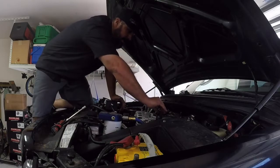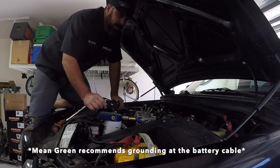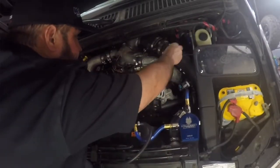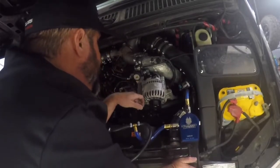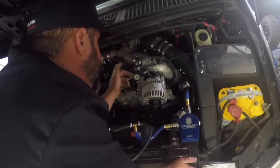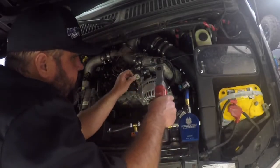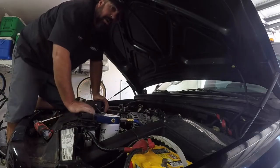We also noticed that there's a secondary ground on our Mean Green alternator, so we're going to take a wire and ground it to either the battery cable or put it right onto the frame. The next thing you're going to do is depress the clip and pull the wire out of the factory alternator. Then we're going to take the three mounting bolts out of the alternator, which are 13mm. On a factory truck you will not have this extra piece on there, but if you do, just pull the bolts out and set it aside. Let's take out the mounting bolts now.